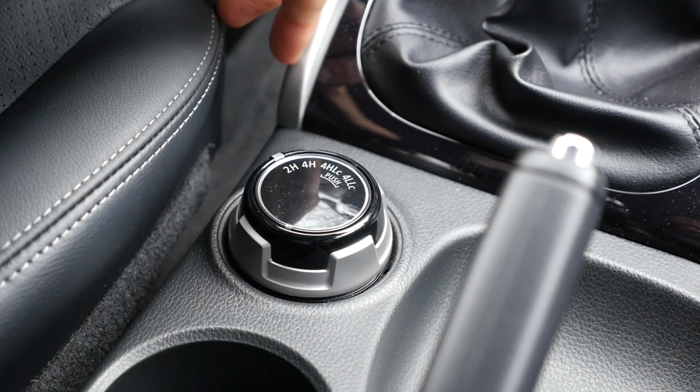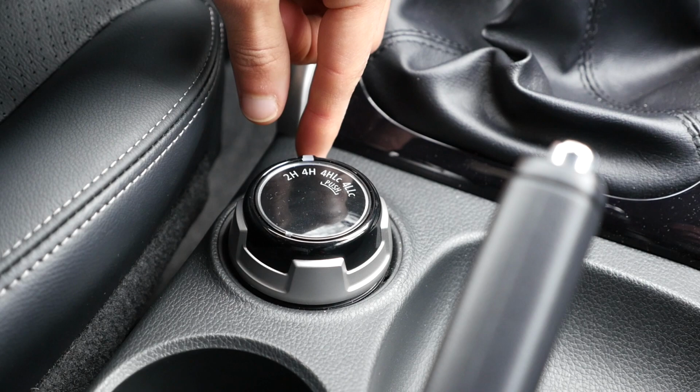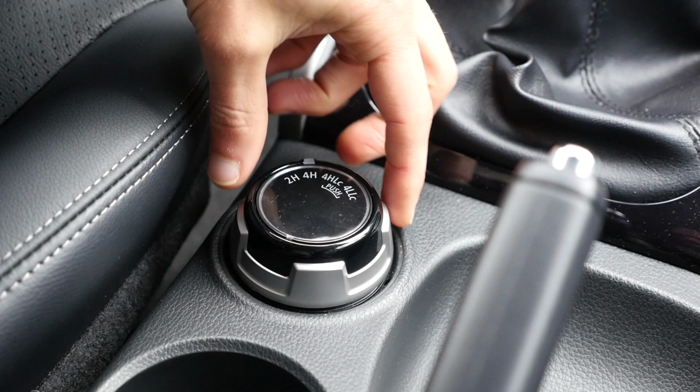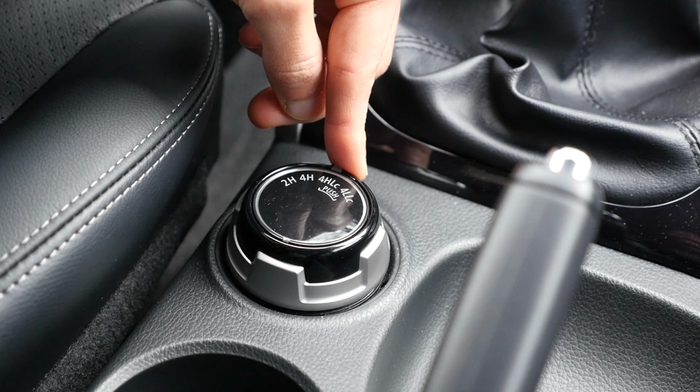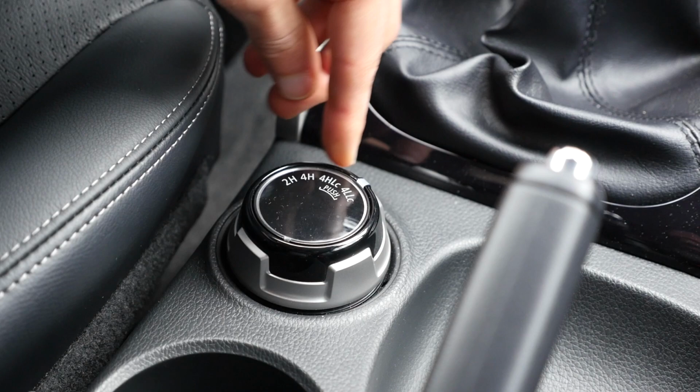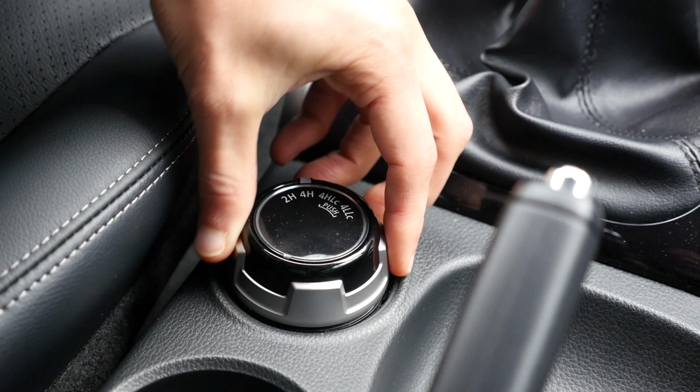Off-road gear selector, pretty interesting. Here, just rear-wheel drive, then four-wheel drive. You can use this one also driving on-road. I can also explain that while we drive, the car is different than some other pickups. Then this one here, HLC, this would be the next mode where the center differential is locked. That's indeed just for off-road. Then if you push it and turn it further, this one would be the off-road gear reduction. You have to stand still then and also put it in neutral for this to work if you really have super heavy off-road situations. So pretty easy to pick, and I think a good handy solution if you're really changing your terrain.